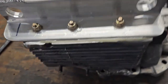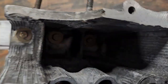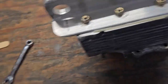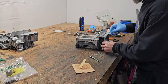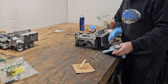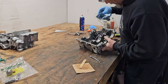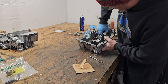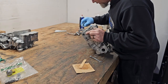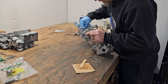She's all oozing out the side, so we'll go through and clean that up. Make sure you get this sealed up good because if not you'll be pulling the engine back apart. Make sure it's all wiped off right there because the backing plate has to seal up against the case right there, and that will be done with silicone.